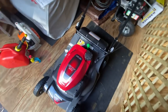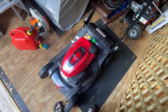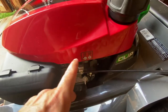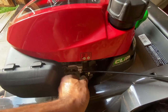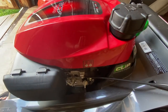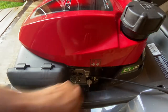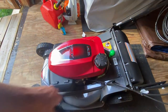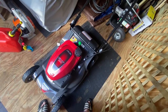Usually mowers I've had really good luck with, especially Hondas. My other one was an HR216. With Hondas, you'll notice too that you have a fuel shutoff. You can see it here — when it's lined up, it's on; this position means it's off. That's great to have because at the end of the season, I usually just run it, turn it off, and let it die with the Startron. I'll put extra Startron in it and let it die with a full tank of fuel — and then it's good for the next season.